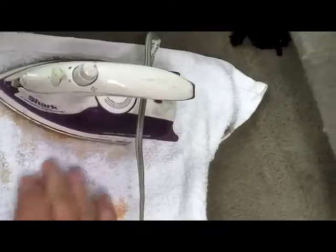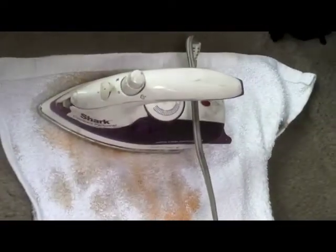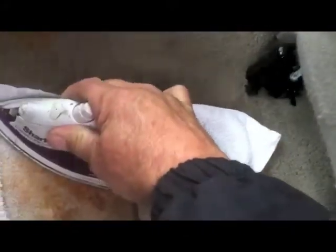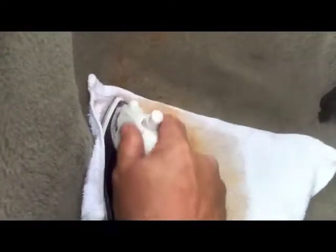When we do this type of stain removal, and we do many different types of stain removals, but when we do this style of stain removal, it's a long process. You have to do it 4 or 5 times over to get all the color out of it. And if you send it to a detailer and see if they can scrub it out first, and maybe they use a citric acid or a bleach or even an ammonia, can damage what's called the dye sites. The dye sites is where the color is in on nylon carpets or synthetic carpets, and you can permanently damage them. And once they're permanently damaged, we cannot pull out this red again.